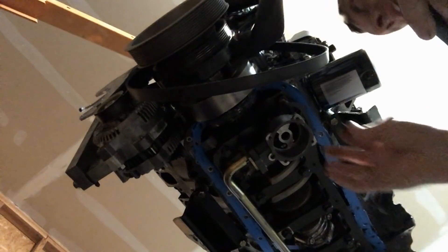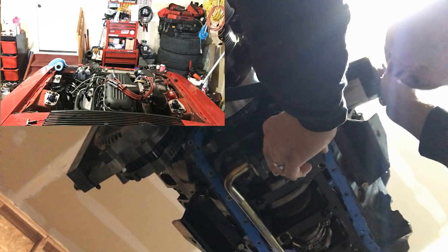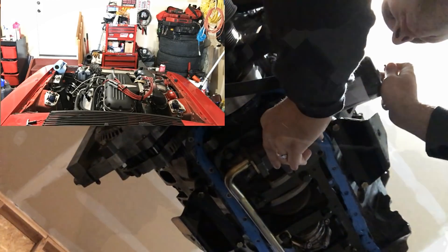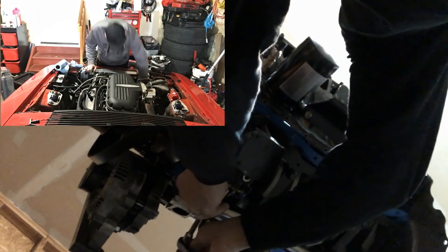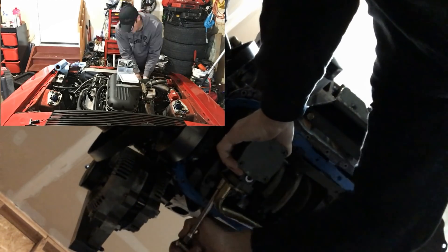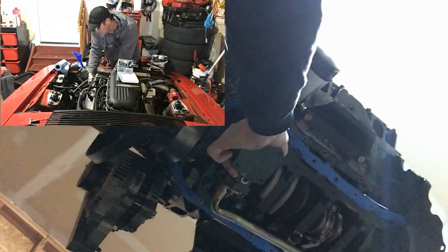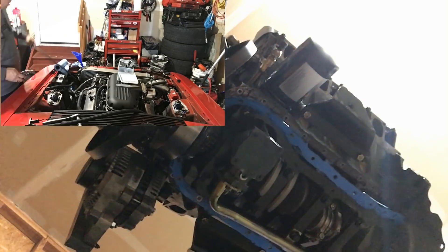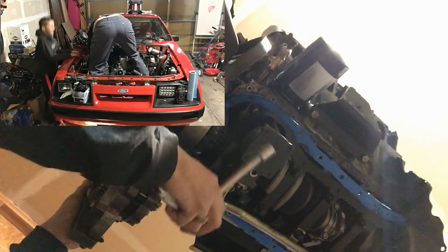I got a very, very tiny layer of silicone there. Along with no gasket on the oil pump, I also noticed that the pickup tube is not tight to the pump, so that is probably the main issue, but I also saw air coming out from around this.